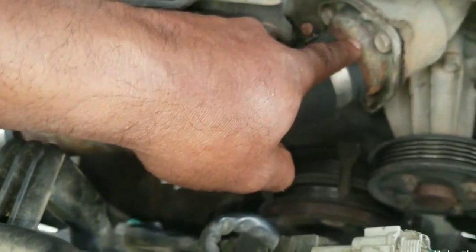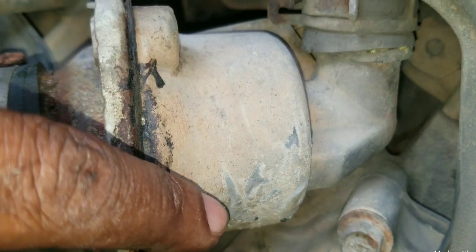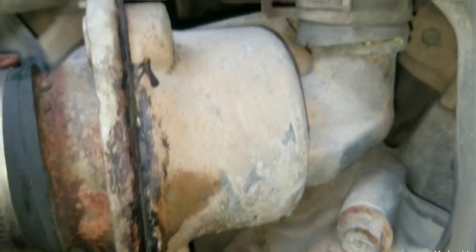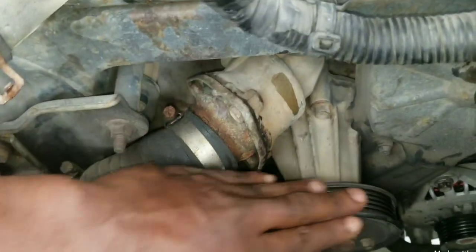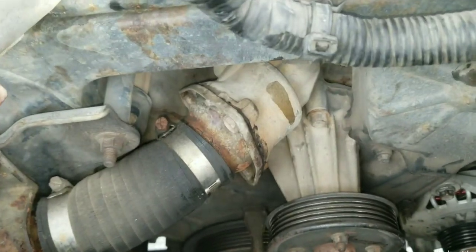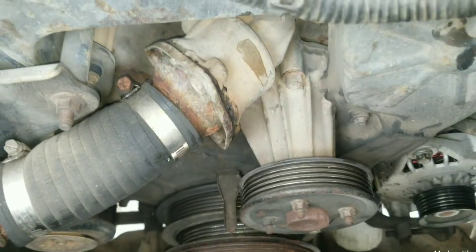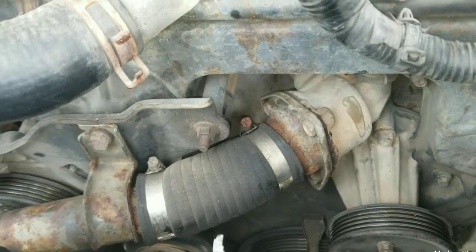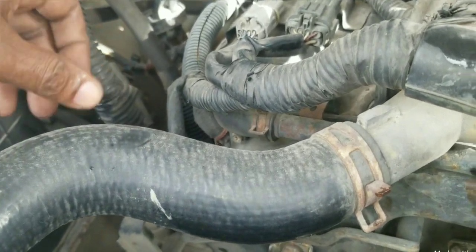You can see all this corrosion over here — get ready, this is going to start to leak from corrosion. Remember this vehicle is now almost 20 years old. Also this aluminum right here — I have some epoxy, a JB Weld aluminum cold bond — this aluminum will also become oxidated or corrosive and you will get a hole in it. The good part is we don't have to change this water pump because if we did we would have to take the timing cover and timing belt off to get in there. This water pump is also 20 years old with 206,000 miles on it. A lot of these Nissan parts are superior — if you can replace with factory OEM parts, for example this hose is 20 years old and also has 206,000 miles on it.